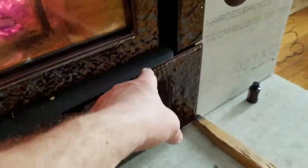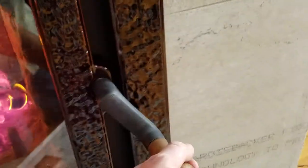The door gap is dragging down here. They use little tiny set screws — grub screws — and they strip out very easily, as the installer found out trying to level it. This thing does not stay tight. Set screws on cast iron are never a good idea. The way it closes you have to wiggle it in. I had it set perfect so it hit a cast iron stop, but the cast iron is so granular and soft that it has worn away even after just a couple of weeks.